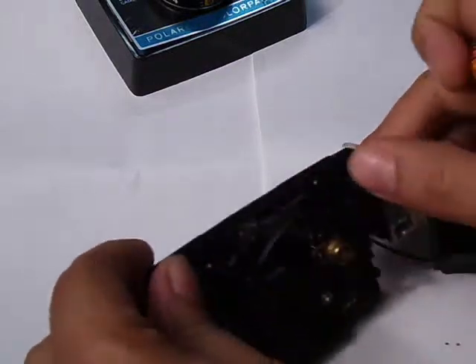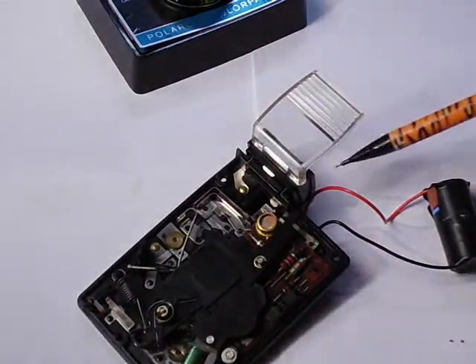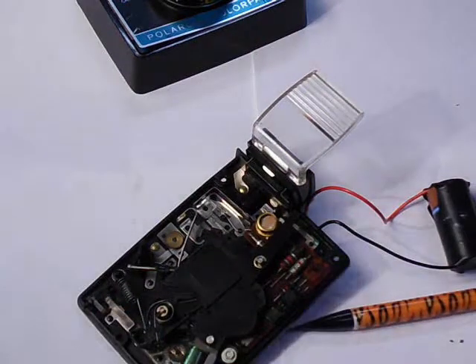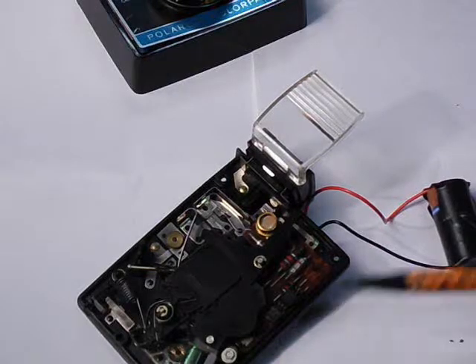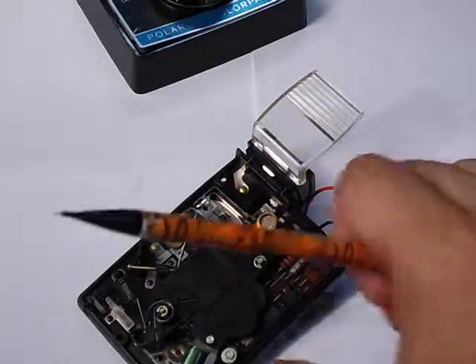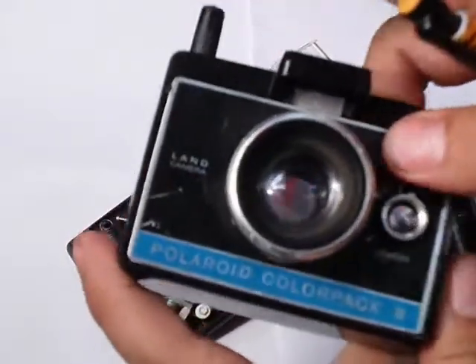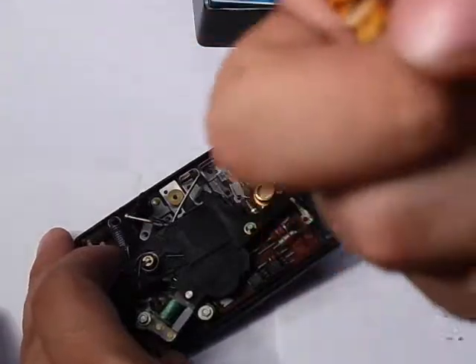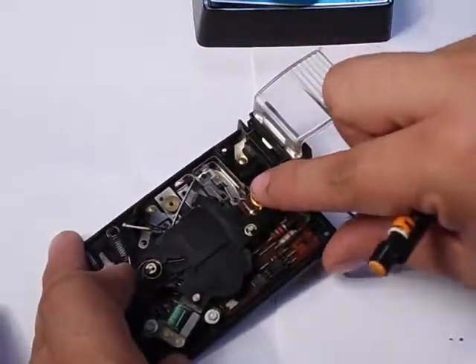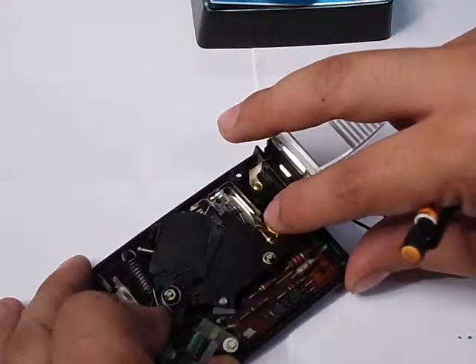The only thing I haven't tried yet is the flash cube, just to see if it goes off. I have some but I just remembered I don't know where I put them, so when I find them I'll put a flash cube on and see if it fires. That's basically how a land camera works. This is the Color Pack kind — this button right here triggers the shutter. I'm using a light for this video, so that's why I'm getting fast shutters. If I cover up the photocell it should be a slow shutter — though it's actually not going now, probably because the contacts came out of place.